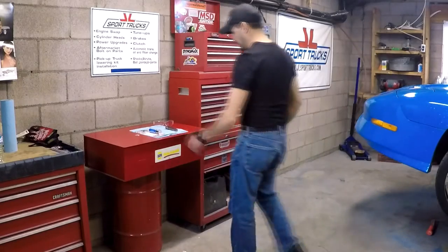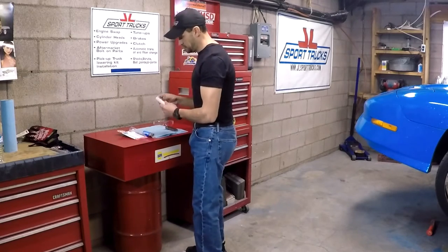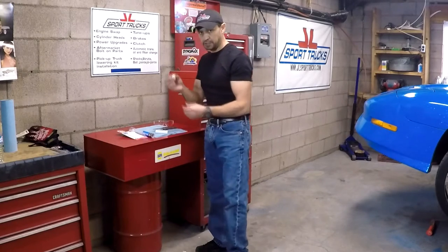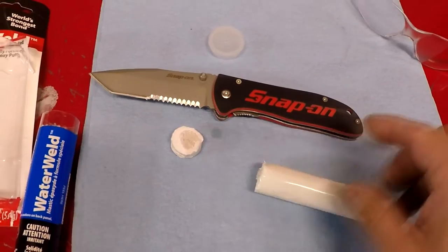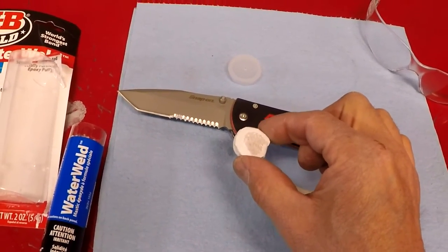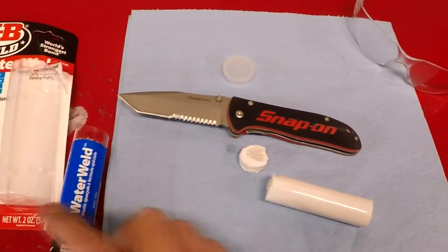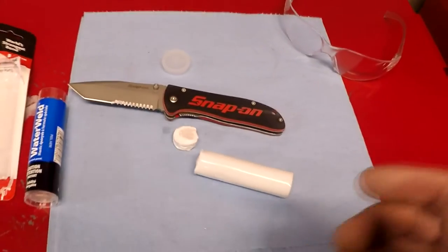Just to double check, I'm going to touch it with my finger to see if it's dry — and it's completely dry. So I don't need to drain any coolant to do this. It's time to mix the product. So let's open the package — it's a two-part epoxy. Just like any other two-part epoxy it has resin and hardener in two different colors. What's next is to mix them really well until they become one even color, and then it's ready to apply. That's how most epoxies work.